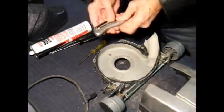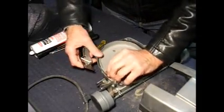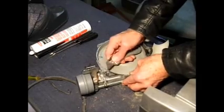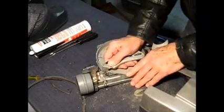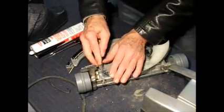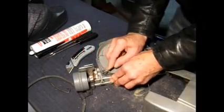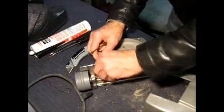The first thing to do is clean off the old sealant. This metal is quite soft, so if you start going mad at it you will take a piece out of it. It's not steel, it's aluminium. So we've got the idea — we'll edit the rest of this cleaning out now.